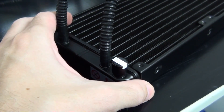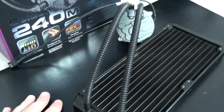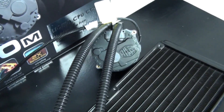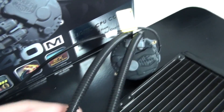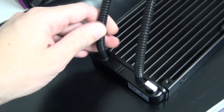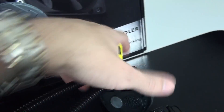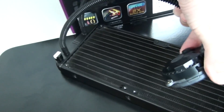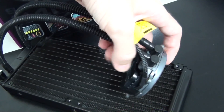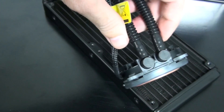The tubing is quarter-inch FEP tubing — extremely durable. You can bend it as far as you want and it's not going to kink or break. It has extremely low moisture absorption and can handle extreme temperatures and pressure. It's certainly not the greatest looking tubing, but you won't have any problems with it. On the radiator side you have non-removable barbs that are part of the radiator, and on the other side you have adjustable fittings — also not removable — that are adjustable to nearly 180 degrees.